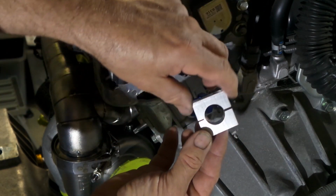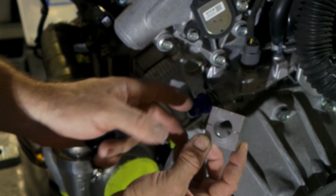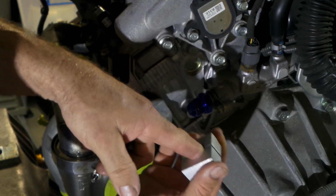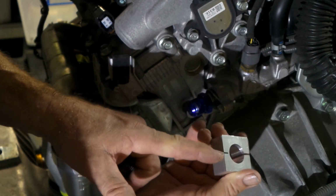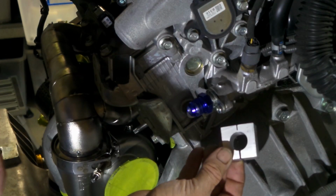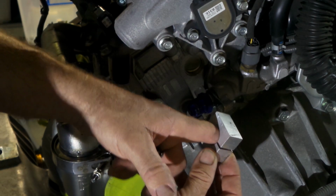So what I've done here, I've just got a piece of aluminium scrap and bored a hole through it, which matches the exact size of the round piece that I was trying to hold, and cut a slot in it, and then just clamp that together in the vise, and that gives you a really, really good grip on the part. Gives you lots of surface area to contact. I've cut a relief cut in the back here, which allows it to clamp in a little bit tighter, a little bit easier, sorry. I did make that on my mini lathe, but if you didn't have access to a lathe, all you have to do is just use a hole saw. Drill a hole as close as you can get it through anything.